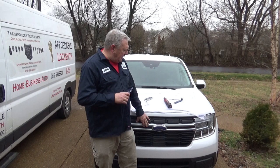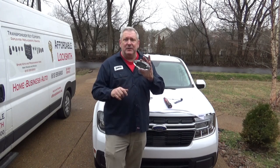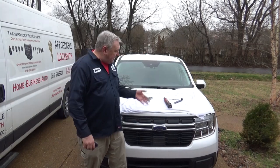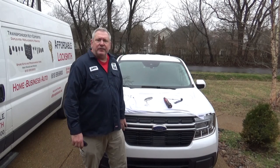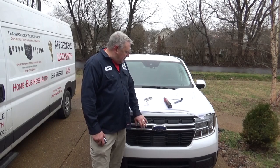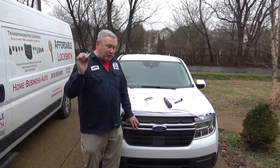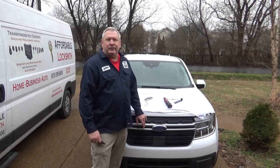The Lariat and the XLT have a similar upper grille portion that's separate, and the XLs are all built into one. I haven't taken an XL apart, but what I'm assuming is once you get the grille pushed back a little bit, pretty much you can take the 10-millimeter bolts off and heat it up and take it off from the front. On the Lariat and the XLT, you take off this whole upper part of the grille. You want to be careful with that — you know how much that thing costs? $350 without shipping, without tax, without anything else. Ford gets $350 for this trim on the top section, and you wonder why they're totaling trucks out.